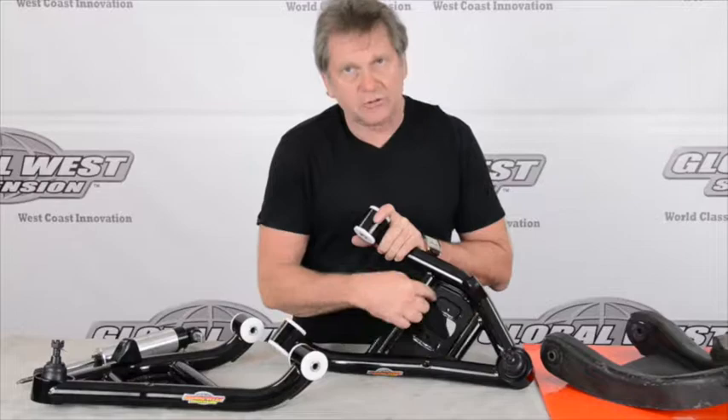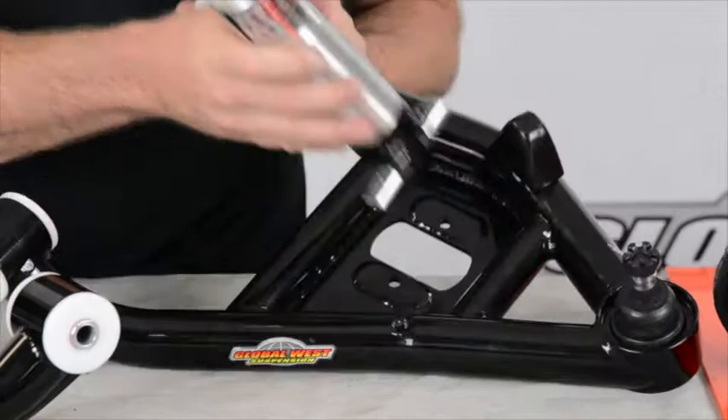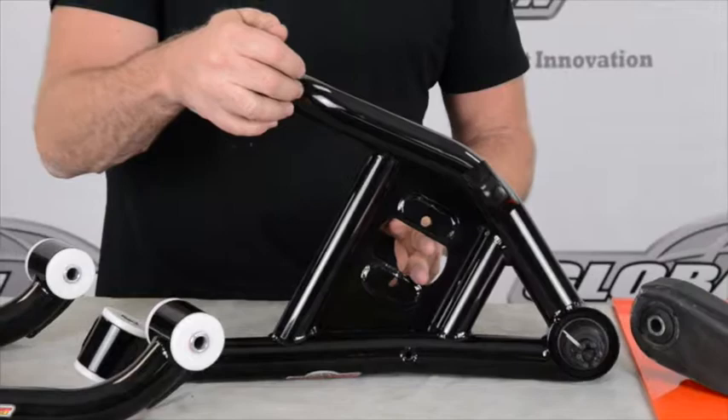If you notice on our control arm, we've got this plate that comes through here, but we also have a doubler in here as well. That's the support where the shock is, because this particular shock now has the spring that goes to it, so all the load is going right through the center point. On a stock control arm, the spring is all the way to the downside out here, and the shock is just dampening the spring. Here, everything is going right through these points, so you understand now why we want to run a doubler through here.